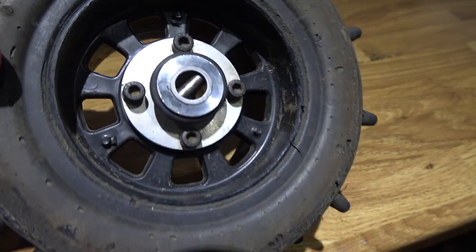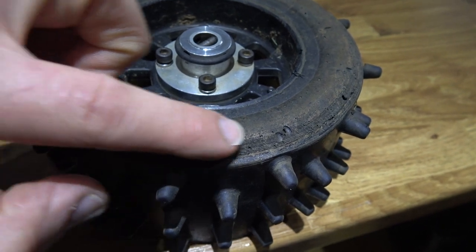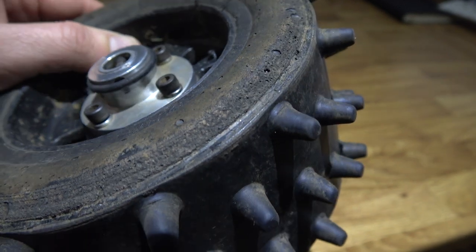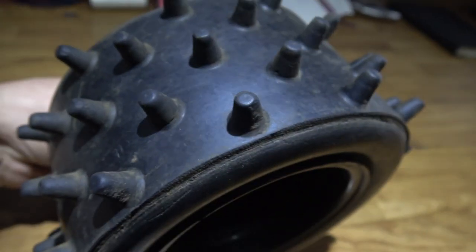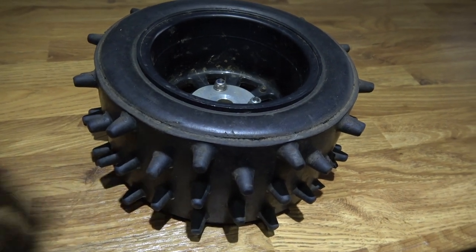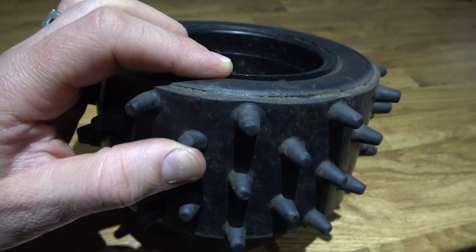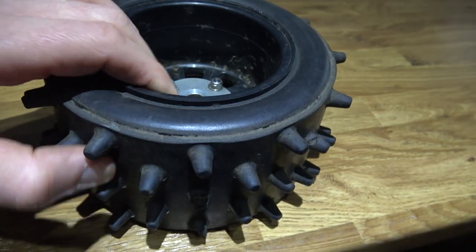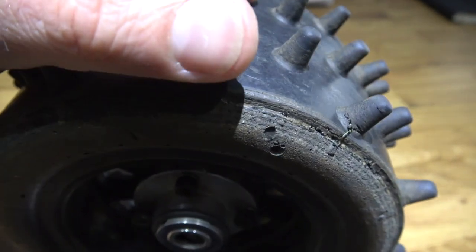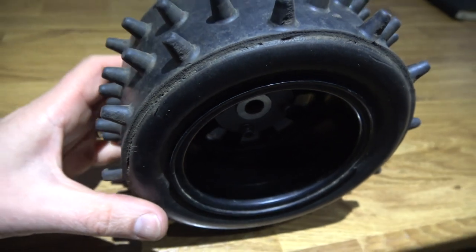You can see the different bits here: wheel, the foam which is glued to the wheel, and then the tread is like a separate layer round the outside, glued to the foam. The spikes seem to be the tyre with the best grip in UK conditions on muddy grass. There are a couple of other styles: mini pins, which are a very small close-knit pin good for tight ground and harder mud. Then there's the knobbies — a lot of people use cold cutter screws in them, screwed in for grip on loose surfaces. And then of course you've got the BRP slicks, which are for tarmac — various sizes that look amazing.